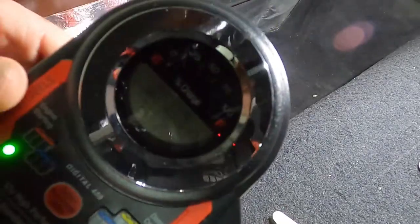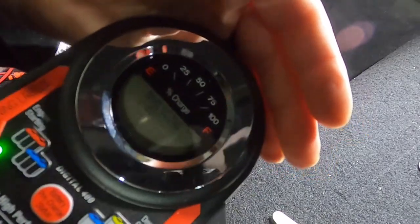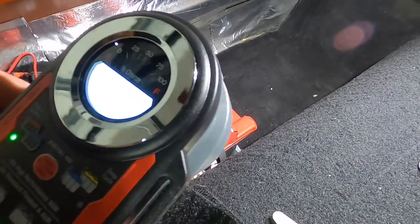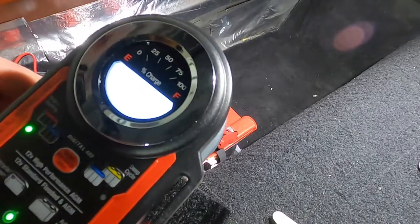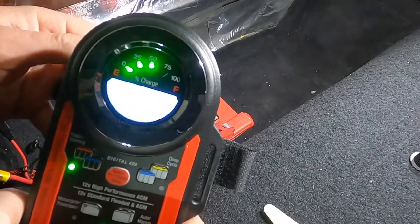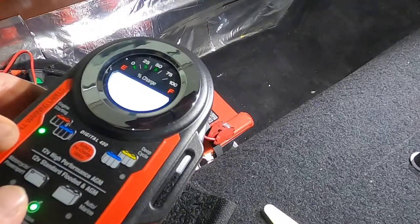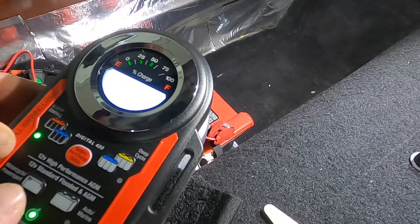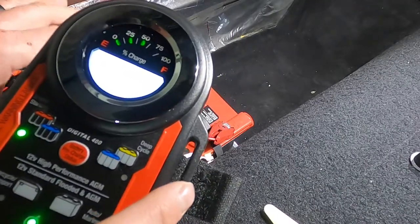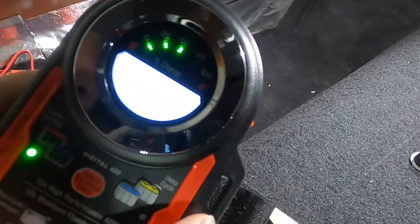You can also shut the backlight off. It just says analyzing right now. Once it is done I'll let you guys know what it states, and then it should go into automatically charging the battery and showing us the percentage. It is done with the test — it was just at 25% and it just jumped up to 50%. It is charging at 12.6 volts and 3.7 amps. The lower the battery charge, the more amperage it's going to put towards it — it's at 4 amps now.